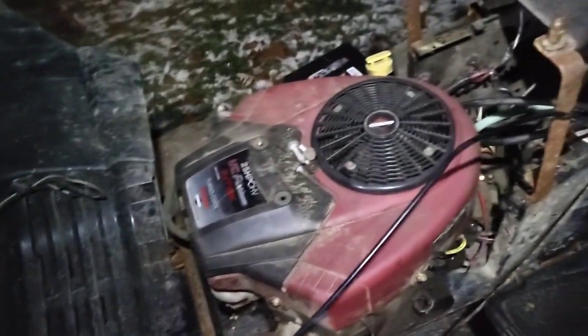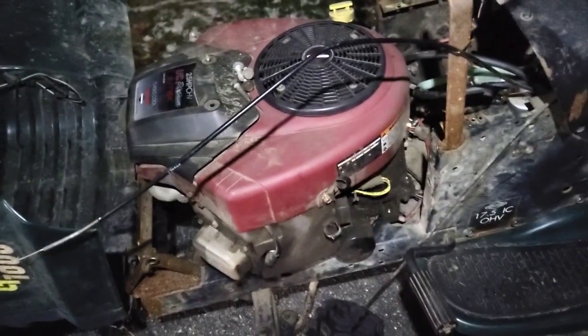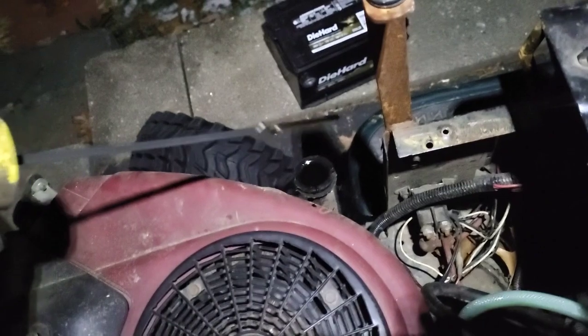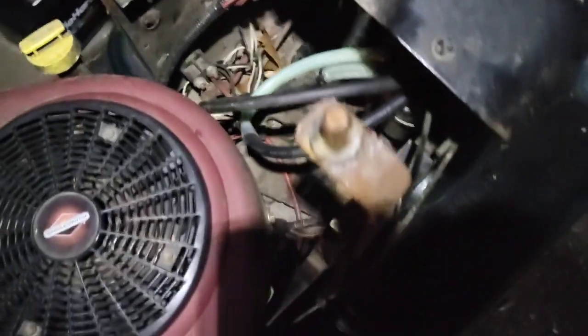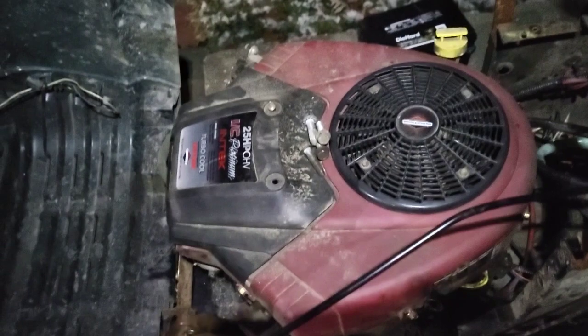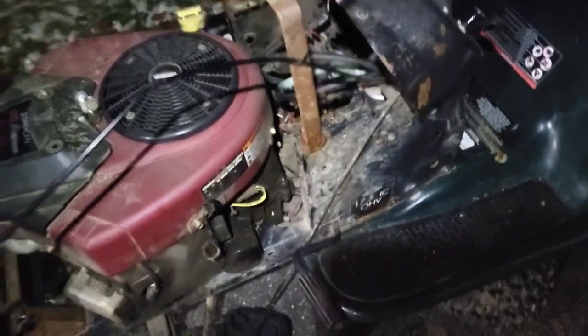I'm excited to be testing out this Intech. What I've got to do now is get it bolted in, do an oil change because I don't know how long this oil has been in here — this engine sat for four years before I got it. I've got to figure out the electrical and hook up all that, and I've got to figure out the catch can because just like with the Oppie, if I roll this over I don't want to have to clean out the carburetor and intake. So we're going to be hooking up the catch can.